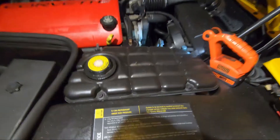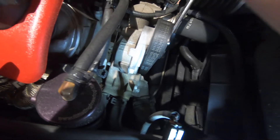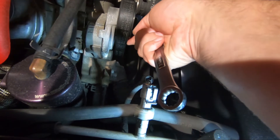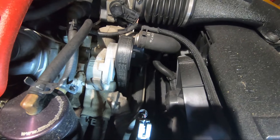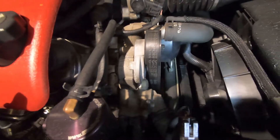After assessing this, I think we can get all these from up top. So this is your main belt tensioner right there — just a 15 millimeter. I'm going to turn it clockwise to undo it, just like so. When you do that, you can release your belt and take it off. I'm going to release this, take this belt off, and then take off the tensioner and the pulley on the other side, which is right underneath your power steering reservoir. That'll have our main drive situation good to go. And then we'll take off all of our accessory drive stuff, which is right down there — it's kind of hidden, but it's not too bad to get to. Let's get this main drive belt off with the tensioner and the other pulley.